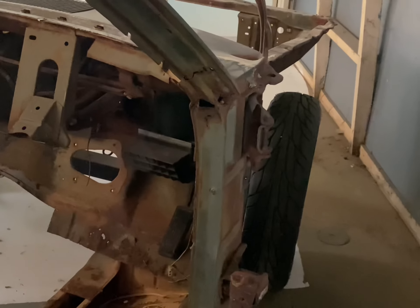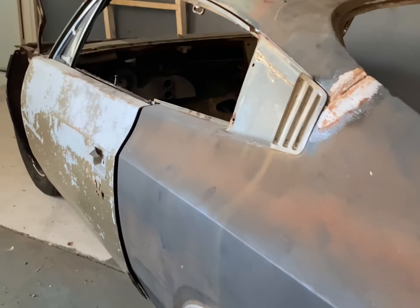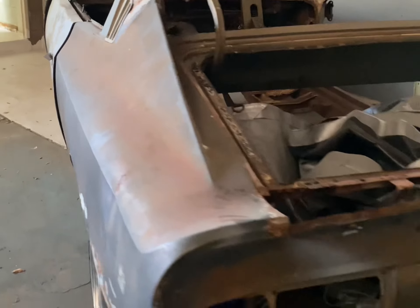The floor's all been cut out and unpicked. Patch panels are there. Under the dash will be mostly empty — we'll put a factory dash in but run a Haltech, so we'll have a screen in there as well. The great part about having the roof opened up now is that as we do the floor work, we'll start to build the cage. As we build that cage, we'll weld it in from the top and we'll be able to get something that's pretty tight to the lines of the charger. Let's call it a silver lining.